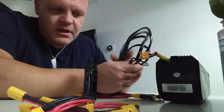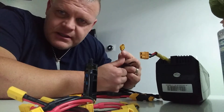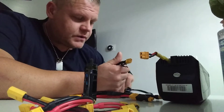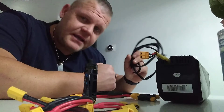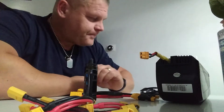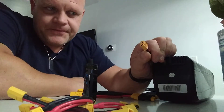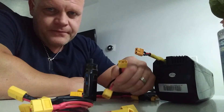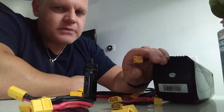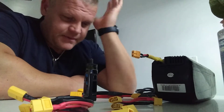Originally I had this 20 amp-hour 48-volt battery connected with a long wire that would come out from the side of the bike. I'd have the backpack on the stealth bike, so this gives me additional juice - 48 plus the other one is excellent range. I can't afford a two-thousand-dollar battery but I can afford two different batteries. I may have to change this connector to a female - I have some sitting around. I need to check if the controller has a female or male connector.